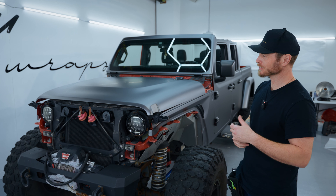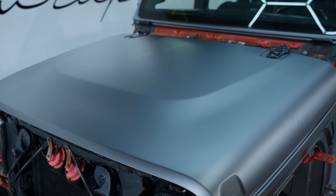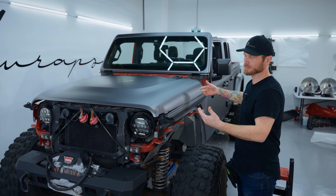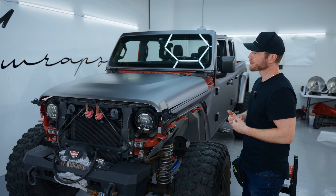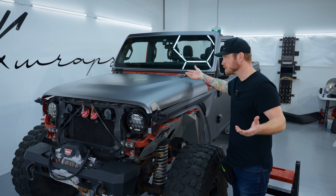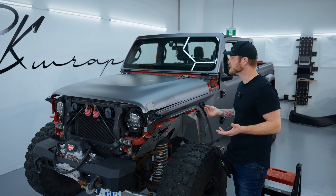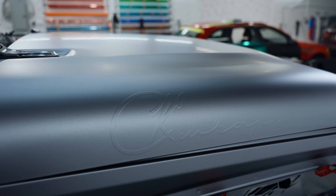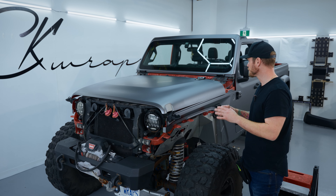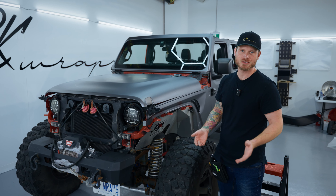This actually went down way easier than I thought it was going to be — nothing was cut out, it's all in there for you guys to see and learn from. I thought it was going to be more problematic in the middle, but because the film is not high-tack — it's a nice low-medium tack — it went down really nicely. I showed you how you can just lift the film back up and put it back down. If you want to make things simpler you could throw down some tack reducer in the center area. Edges, corners, all the way around, heating, cutting, trimming, post-heating — all that stuff was in this video. Hope you enjoyed it, thank you for watching, take care.